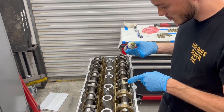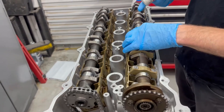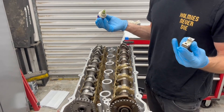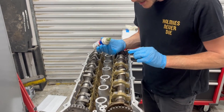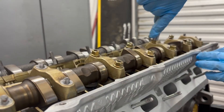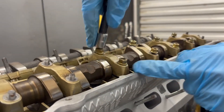This cam's got some pretty decent scores — you can see right here when you look underneath the lube I just applied. But with these cams and these cam journals, it does not matter if there's mild scoring like that at all. My buddy even polished this one up on his lathe a little bit just to clean it. Actually these are Jackson's cams — I have those same score marks on my own cams, so it's really not an issue. I'm going to do a quarter turn slowly on these — you can see the cam is lowering itself down into place as it presses the valves open on cylinders two and four.